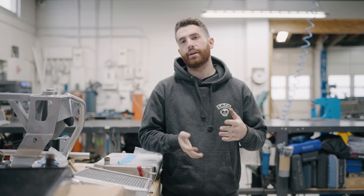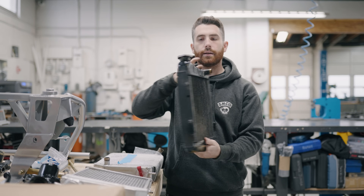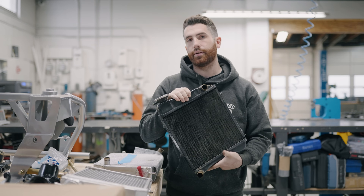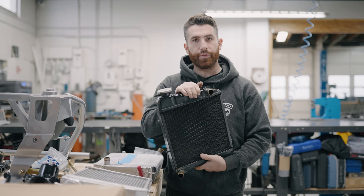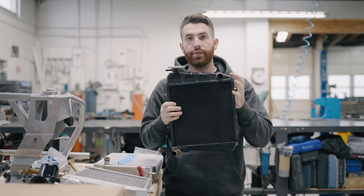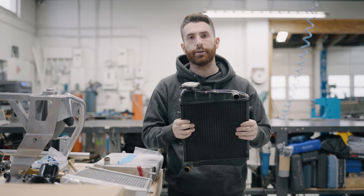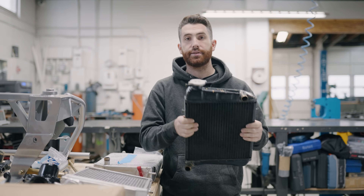Another really important component of cooling a Classic Mini is heat transfer. The classic radiator style faces sideways in the car, so it's extra critical that the radiator is in good condition. There are many different styles: the factory steel-style radiator comes in a couple of different core thicknesses. Obviously the bigger the core, the more cooling fins and passageways, and the more it's going to cool — though a thicker radiator can be harder to fit. Make sure to get the radiator that best suits your application.